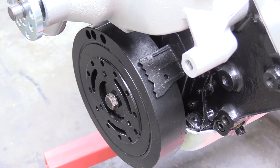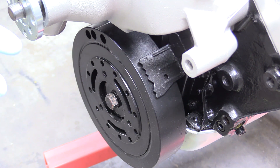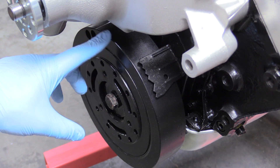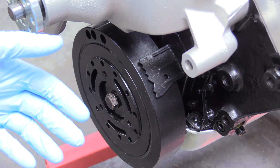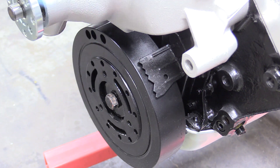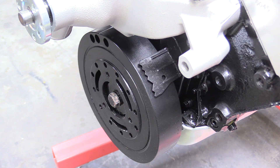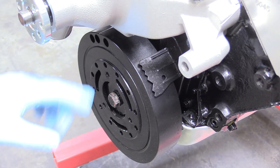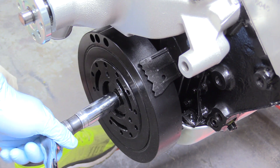There are two ways to determine whether you're on top dead center on number one, ready to fire. We're going to show the easier way first because we're in a garage situation where the engine is on a stand. Now, it's a little confusing because the timing mark comes around twice — one on the stroke we actually want, which is the combustion stroke, and then there's the other one which is wrong, called 180-ing. We're going to be turning the engine over to set up the distributor, and we're looking for that white timing mark on the harmonic balancer. I painted mine white for convenience — sometimes they're just a groove.